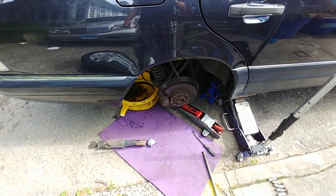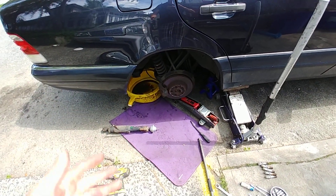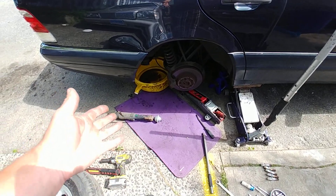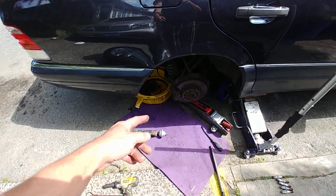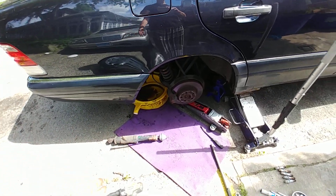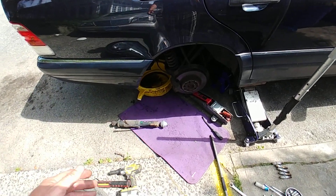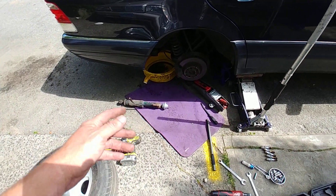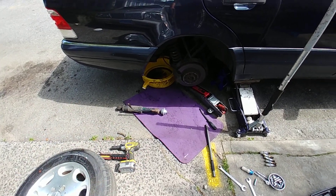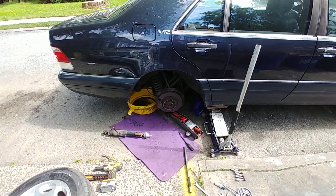So to summarize: this is basically the noise that many people ask about - the banging or thumping in the back. Usually it's the strut, and secondarily it's the bushing. Either you replace the whole thing with a new one, or you do what I do and try to save some dollars on buying a new strut. That solution works. Okay, this is it - Victor here from StoriaMercedes.com, thank you for watching.